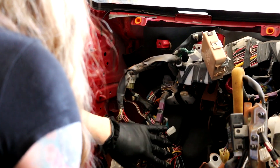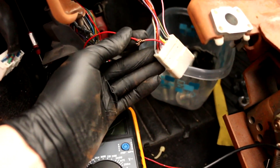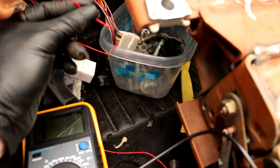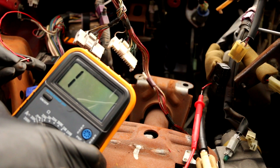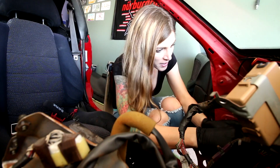Steering column out of the way. This is how it was when we got the car - this wire was cut and spliced with this jumper, because this is the rest of it. This is where it was cut, and here's the rest of the wire that it connects to. This goes through this harness right here and it comes out over here, which plugs up near the ignition. This is for the ignition switch to start the car. The problem is I have no continuity - absolutely nothing.